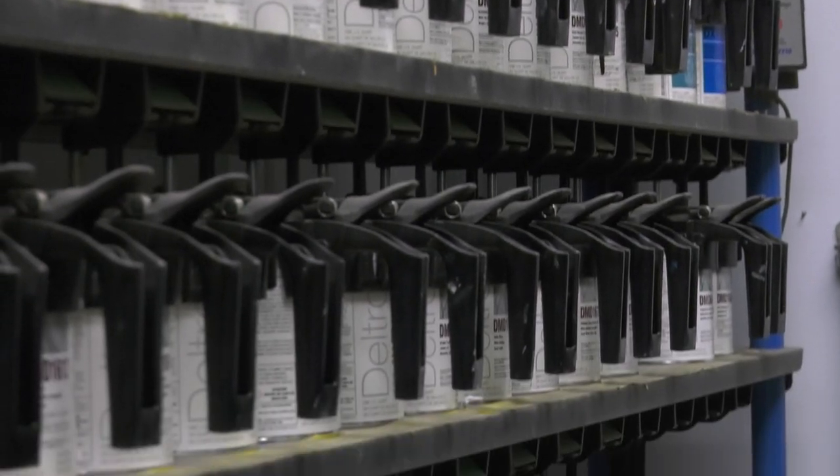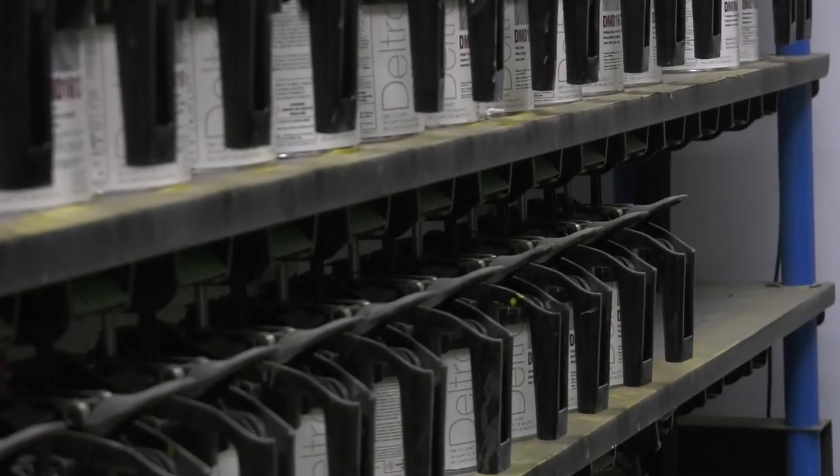I'll mix up just a small amount and do a spray out to make sure the color is perfect before I call APS and get our three gallons coming over. Because if I got three gallons coming over and that color is off, that's just a waste of paint. So if the color is off, I can actually tint it here, make sure I get it exactly the way I want, then track how much I use of different colors to get it correct. When I call APS, I tell them what I did to get the color perfect and they do that exactly. I'm excited — we haven't done this color, so I'm definitely excited to see how it matches. It's a bright color with a lot of metallic — it's really going to pop.